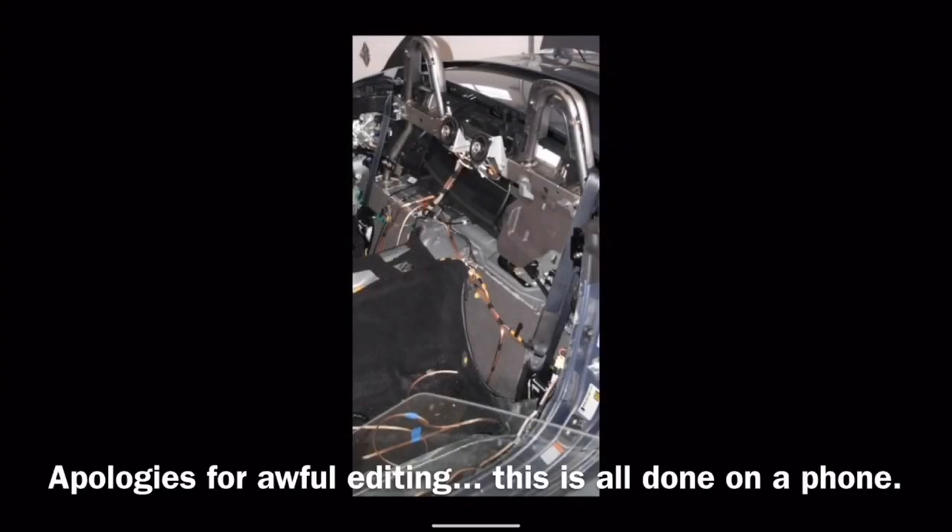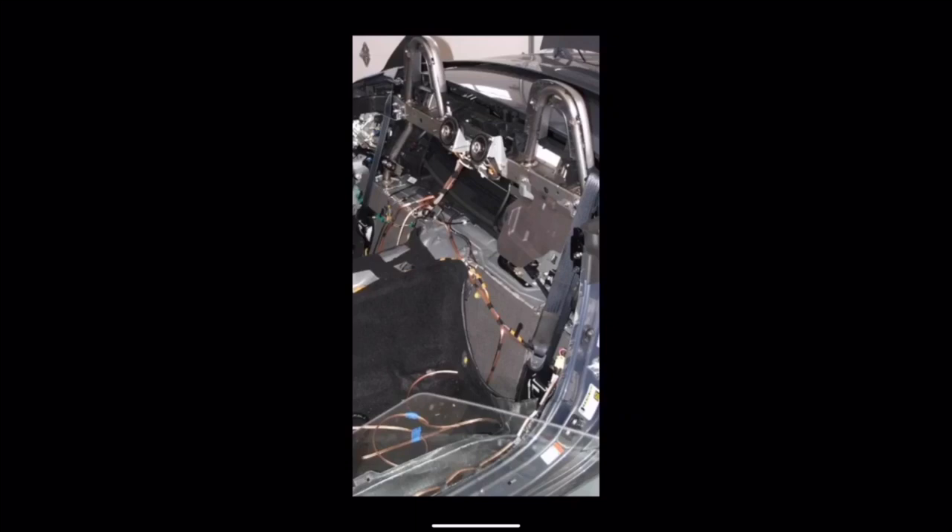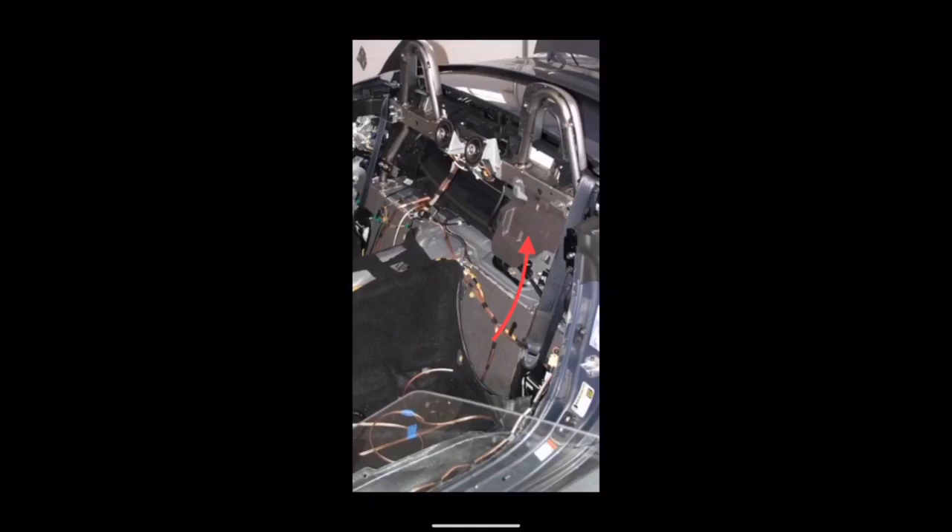If we look at the interior of a power retractable hardtop MX-5 with the interior plastics removed, we can see the extent of the problem ahead of us. First of all, we need to find or make mounting points for the power retractable hardtop module, which is located here, and the speakers here, the hardtop latch that secures the roof in the down position, which is here, and the side mounting brackets that fasten the legs of the roll bar to the side of the vehicle, which are located here. There's then the seat belt guides that the new roll bar has no provision for, which are located here.